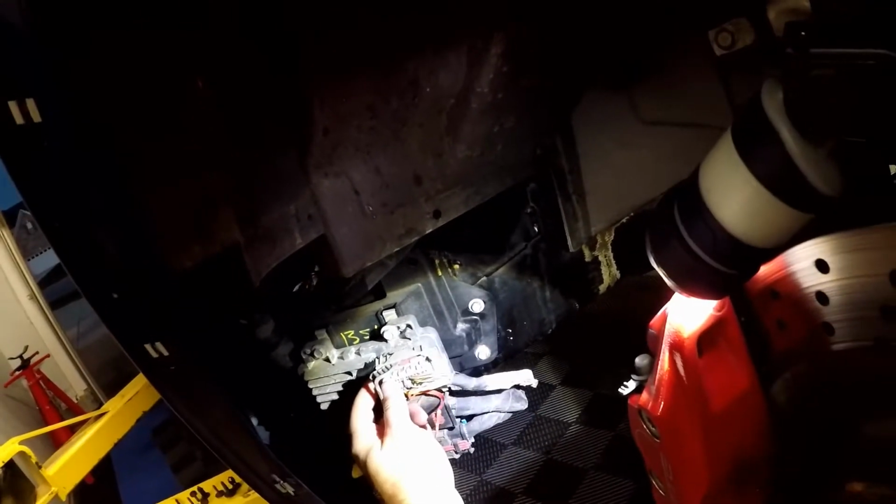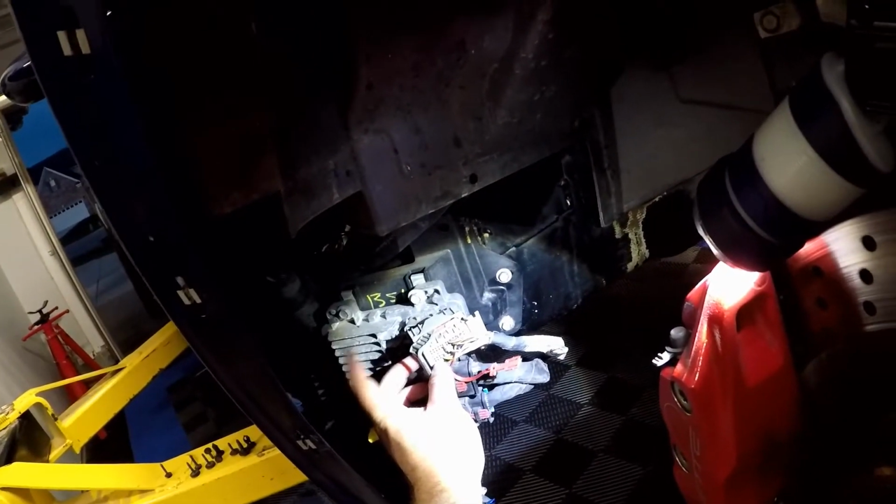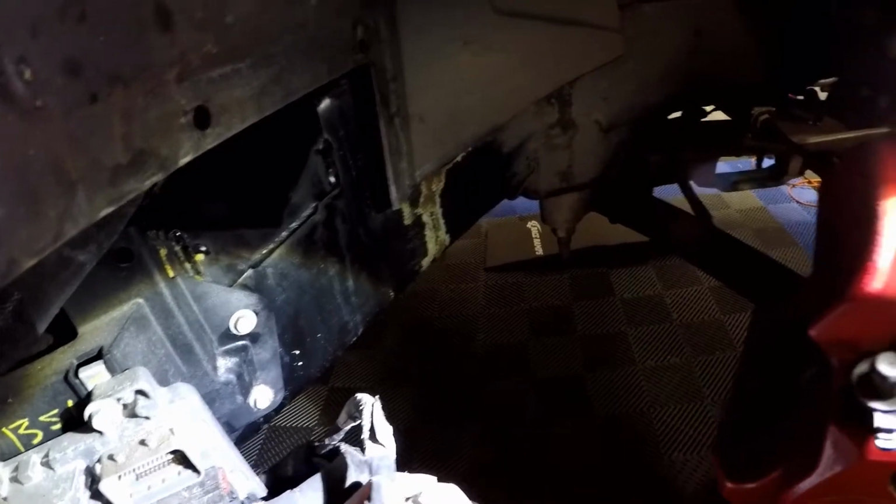And pin 4 is gonna be, so if your connector came off the car like this, all right, pull it toward you, keep the part that was facing the passenger side door facing down. You see number 1 right here. So you see number 1, the brown wire is 2, the orange and white wire is 3, 4 is the next one. So 1, 2, 3, 4 down from the top. If you hold the diagram the same way. Actually, you know what? This is actually from the bottom.